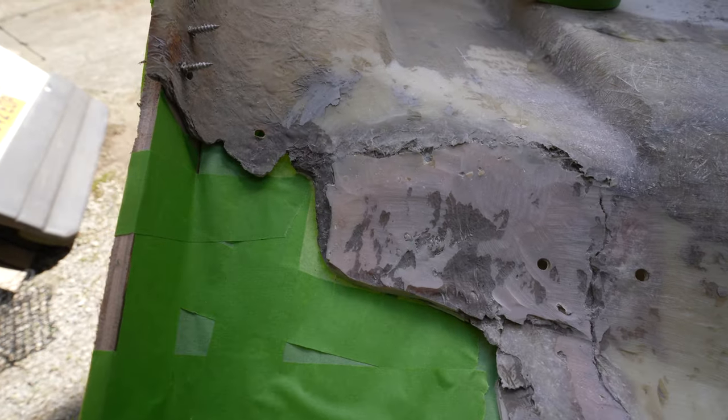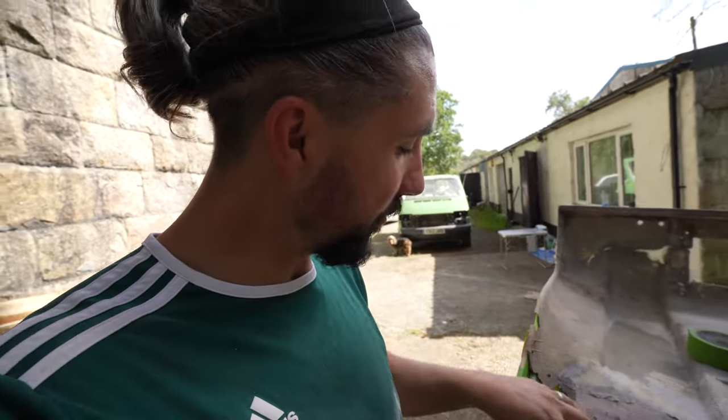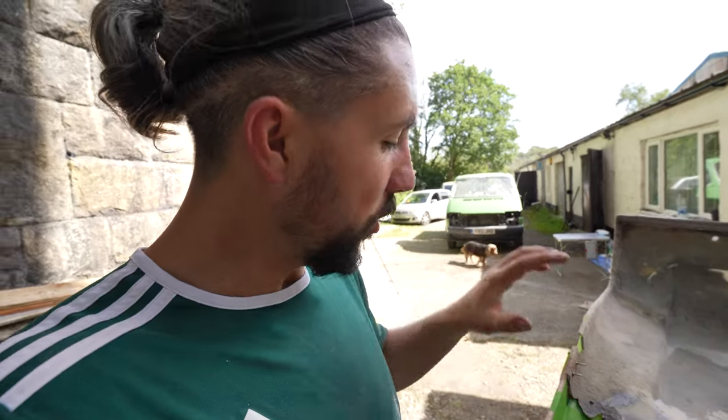There's a massive big area missing from here, so what I've decided to do is tape it all up and start layering fiberglass. Then I'll remove the tape, see what it looks like, and if I need to apply more I'll add it on the other side to make it super strong. I've really enjoyed the fiberglass process - it is a horrible messy job so I've made sure I have my mask on, but repairing the old parts inside the van has been a fun activity and it's another skill, another feather in the cap.